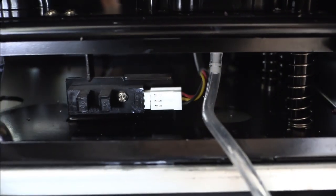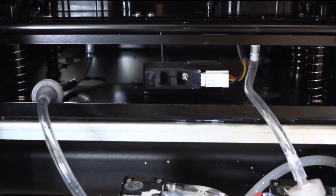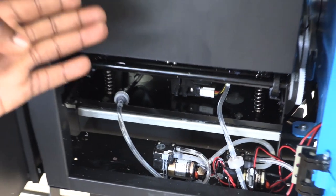If your ink level gets too low and you don't top it up, you run the risk of burning your printhead. When the nozzle is pulling ink and there's no ink in the tank, it will be pulling air. And if it's pulling air, it's going to damage your printhead, which is exactly why you shouldn't be doing it.